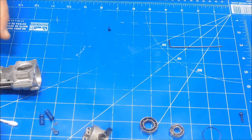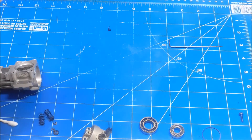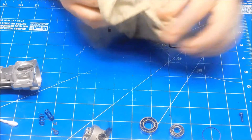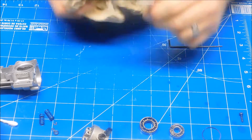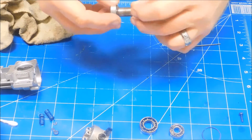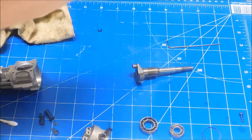When you get lucky, you get lucky — I took the crankshaft out just to see if I could tap that rear bearing off, and sure enough I was able to. The pinion and the little collar all came off with it too. I'm just now removing it from the totally awesome cleaner bath. It's cleaned up pretty decently — I'll probably get a piece of 1500 grit sandpaper saturated with 3-in-1 oil and dress that area up a bit.